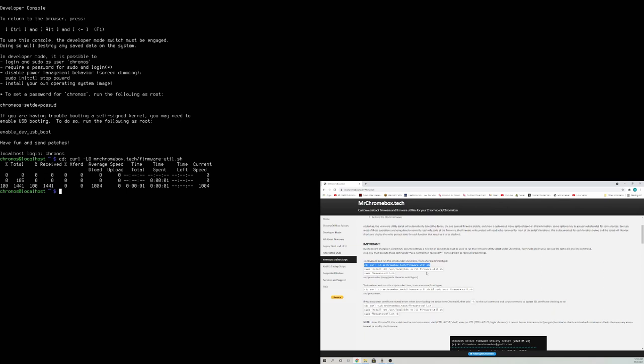If you get an error right here where it asks for an SSL certificate, then you need to go down to the very bottom step on this page for Mr. Chromebox and follow these instructions to do it. Some of these Chromeboxes are locked with an SSL certification. Some of them aren't. Mine in particular is not, but I have run into this issue before. So follow these steps if it comes up with an SSL error at this point. If it does not, we're going to move on to the next step, which is typing in the second line,